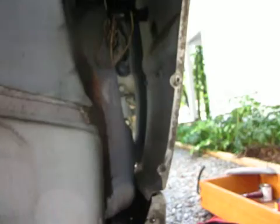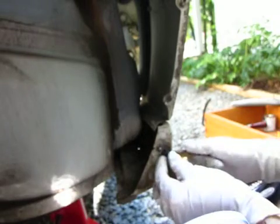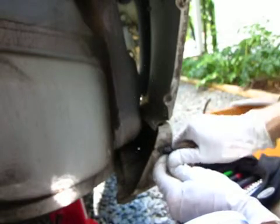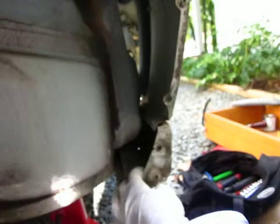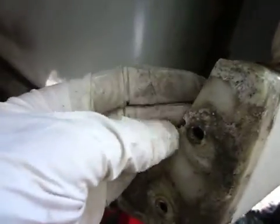And then down here, this is actually on the plastic part of the body. Got to be a little bit more gentle, because I'm guessing that the aluminum rivet is actually more durable in some ways than the plastic of the body. Don't want to crack anything. Have to get in there with, you can see there's some stress cracks, and I think it's basically looking pretty good. So I got all those holes ready. I'm going to just do the front side too, which is just this guy.